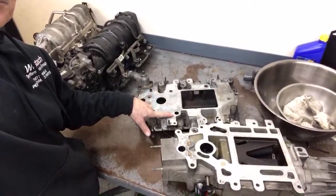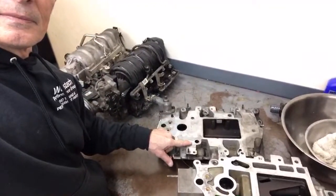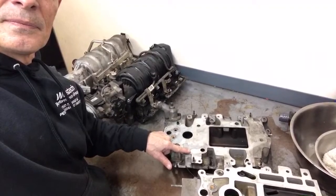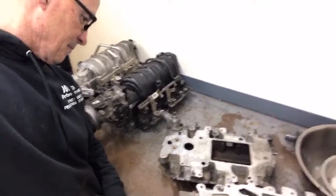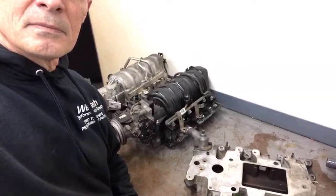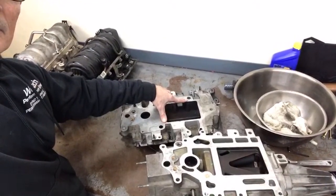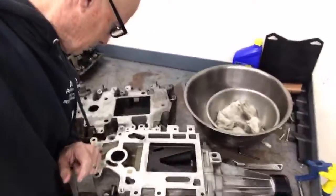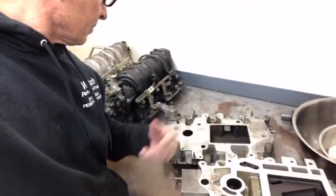So I need to cover this. Is that what people are saying? That's what I'm thinking. It's got to be this one or this one. Eeny, meeny, miny. The inlet for the PCV. Where's the inlet at? Yeah, these are the PCV holes right here, right? So are those getting pressurized? Oh, the inlet comes through the throttle body to the blower case. Okay, that makes sense.